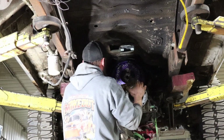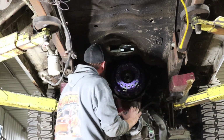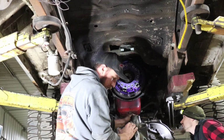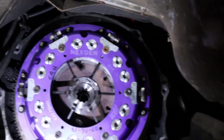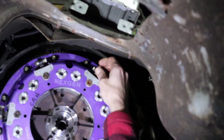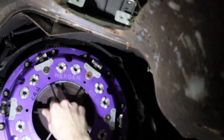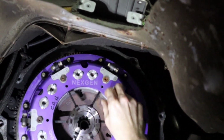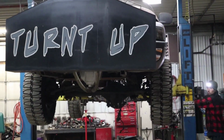And that is a nice clutch. Too bad it's too big for the location it was in. Triple disc clutch, brand new. I wonder what went through. I bet it was one of the fingers, the weights right here. It was bolted in a bell housing that needed a 1/2-inch spacer in order for the clearances to be right, so it was technically smashed in there, and we're thinking that's why nothing would turn. But time will tell. Coming down.